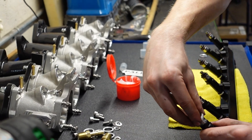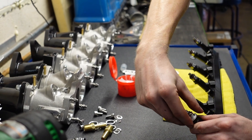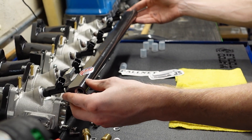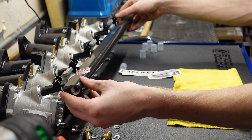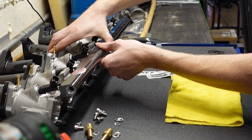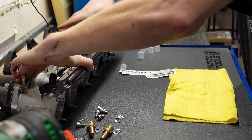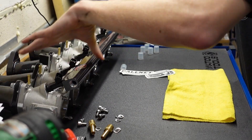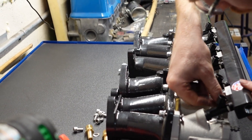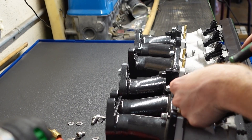The adapter ring drops right onto the injector, past the sealing O-ring, and sits flat against the injector body. Now locate the fuel injector and rail assembly into all six injector bores, taking care not to bind it up. Carefully seat each injector and locating ring into place until it drops into the injector bores. Once the rail is completely dropped in, install all of your fuel rail retention bolts and tighten them down. We advise using red Loctite on all fasteners to keep them from vibrating loose in high RPM operation.